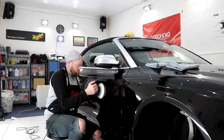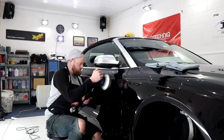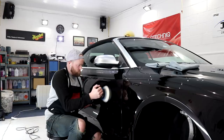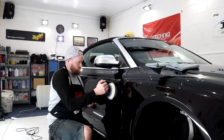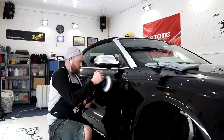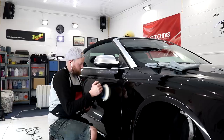At the start of day 6, I had the objective of completing the entire refining process and to get the arches and brake calipers protected. I made a start at 8 a.m. with refining the paintwork using the same type of ultra-fine finishing pad and the white Rupes ultra-fine finishing polish. I spent the time required on the RS5's paintwork and had it back to a deep gloss finish without any issues.